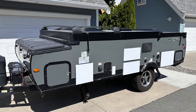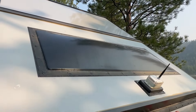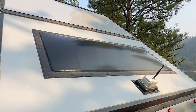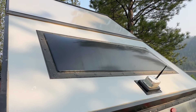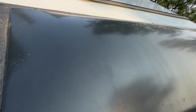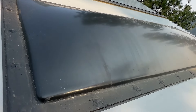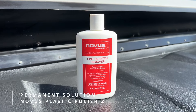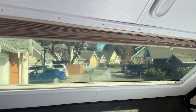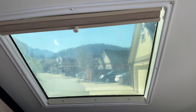It's nice to have light coming in, but we've got the two big windows on either side — and honestly you can't see through them anyway. They're so smoked out and get so gritted from road grit and dirt that they get completely sandblasted and you just cannot see through them at all. To remove the haziness of the plastic windows I bought a bottle of Novus Plastic Polish #2, which is a fine scratch remover. I applied it with a buffing wheel and after only a few minutes on each window I could finally see out of them again — the perfect product for this application.